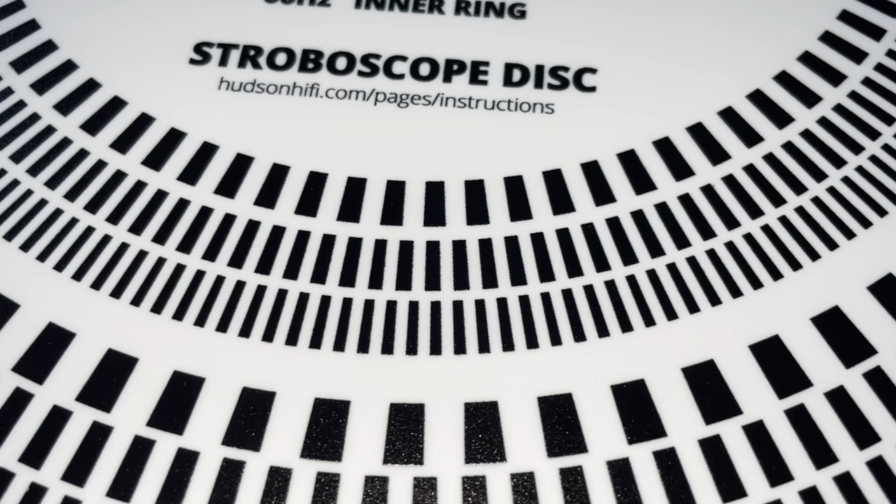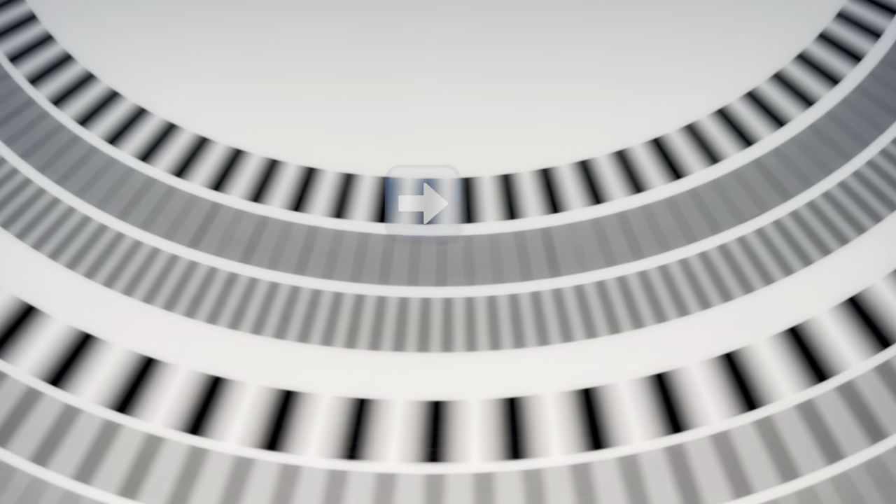Here is arguably the most important thing — speed accuracy. I'm going to turn the unit on, put it to phonograph mode, and spin it up. At 33 RPM it is fast, which is predictable — these seem to always run fast, not slow. There will be a little drag introduced when the needle drops. Going up to 45 RPM — also a tad fast. At the top, 78 RPM is fast as well. For testing purposes it's not a huge deal, but if you received a unit running a little fast, you may want to make a speed adjustment, though doing so would void your warranty.